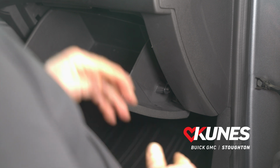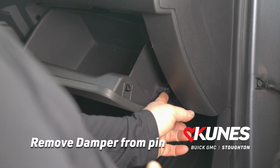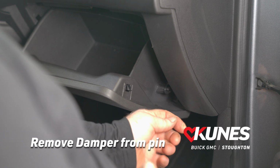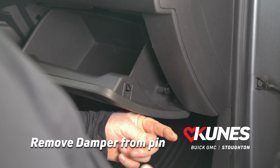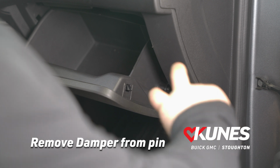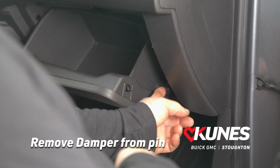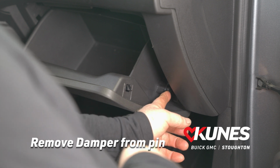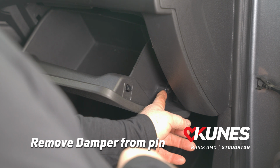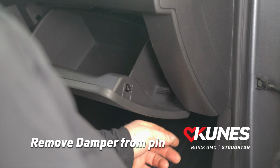So the first step after opening the glove box is removing the glove box door dampener from this pin. There's a plastic pin sticking out from the side of the glove box. And you're going to reach behind with 2 fingers and you're going to pull back on the dampener arm and release it off of this pin. Now the pin has 2 little dimples on it that keep this from popping off, so there's a little bit of force required. So I'll get in there and I popped it right off.